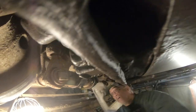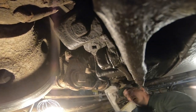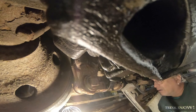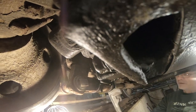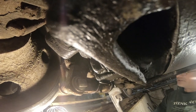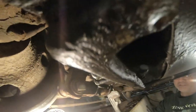That's better. I don't know how much to tighten that. I think we decided last time — put it tight and then took a little bit off. No, we just went up to like an eighth on one side and left it. I think what happened here is somebody left the ratchet on, and that's why this shoe wore out — because we had set it so we had to come under here and adjust them so you don't go through brake shoes, because we apply the brakes too much.